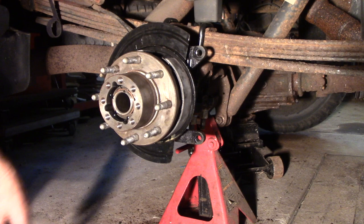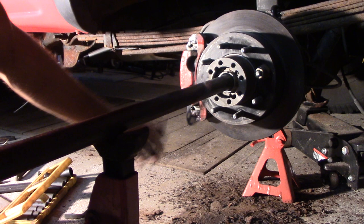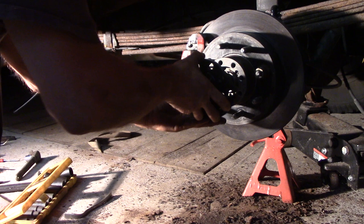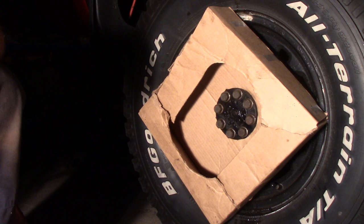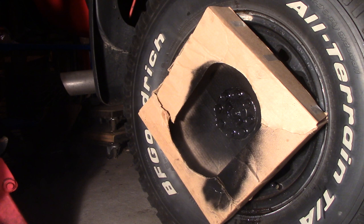I've been working on this way too long for a parking brake — it's just ridiculous. I mean, the amount of work involved on a parking brake — who needs a parking brake for an automatic? Apparently the inspector wants to see it, so that's what I'm doing. Put this axle back in. I like to use one of these metal gaskets, or you can just use some gray silicone stuff, but I cleaned everything up, so I'm just gonna throw this axle back in. Then put the caliper back on, put the tire back on, blah blah blah, shined up my rusty bolts, just gonna hit this with some paint to protect it a little bit.